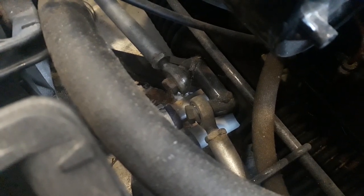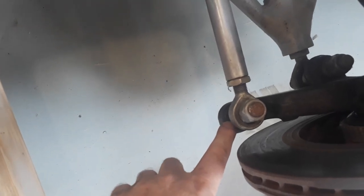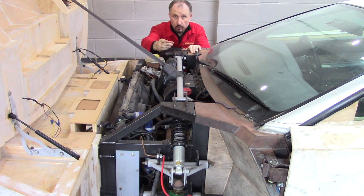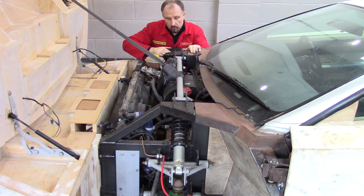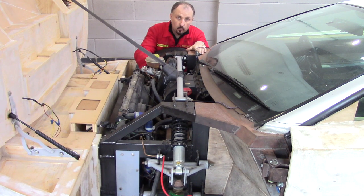One of the good things from the Audi A6 donor car is that it had a centre-point steering rack, meaning the steering rack arms come from the centre of the rack and travel all the way out to the hub carrier. The good thing about a centre-point steering rack is that I can actually lift the centre point up or down depending on the height of the car, so this ensures the steering arm is always parallel to the lower wishbone when the car is travelling forward.